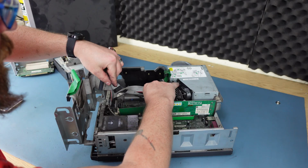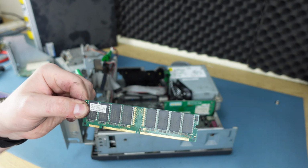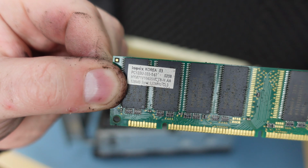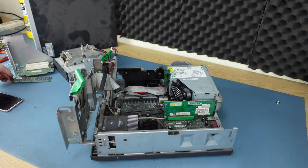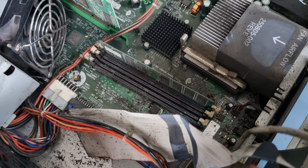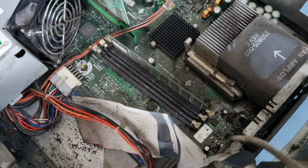The RAM installed in the motherboard was 128MB of PC133 SDRAM, which is really weird. I've never worked on a Pentium 4 system which didn't support DDR RAM. I had no idea there were chipsets for the P4 architecture which used the older SDRAM standard. Anyway, there are 3 slots available on the board, so I'll have a look in my parts bin later and see if I can bump that up to something more suitable for an XP build.